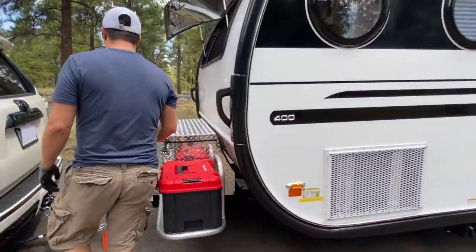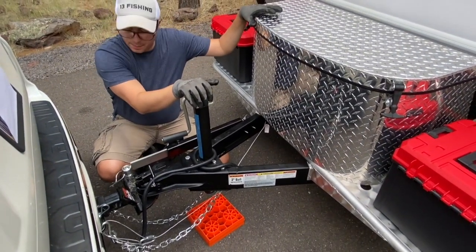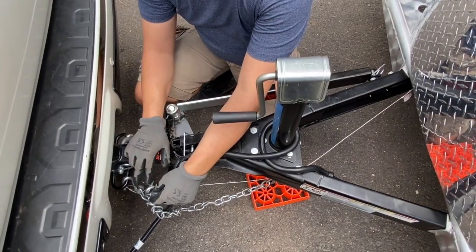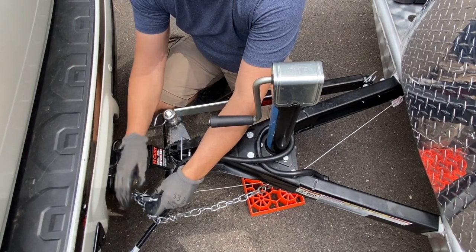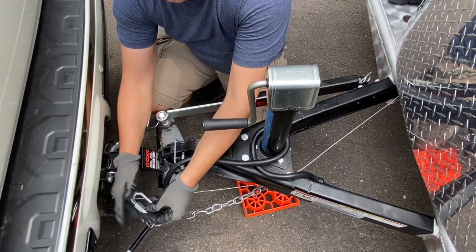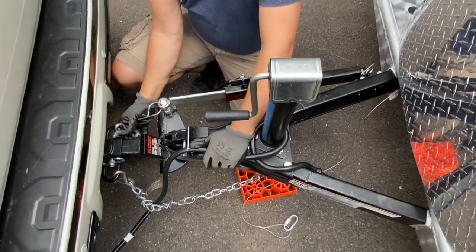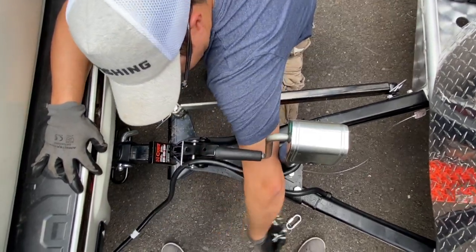Over here at the ball joint and tongue jack. What we like to do — I like to work backwards a little bit, and on the hitching video you'd see me going the other way around. First, I like to take off the D-ring. The D-ring and the brake cable are all on their own — not hooked up to anything else — and that is exactly how you want it. To take it off, just screw that down and screw it back together. Keep the D-ring on there; don't take it out or try to place it somewhere else so you don't lose it. Place that off to the side, then go ahead and take the two chains off to the side as well.